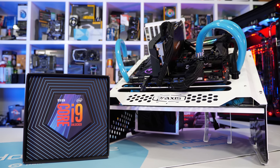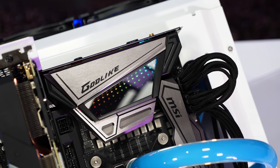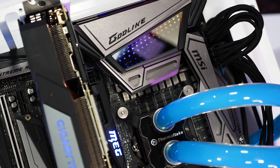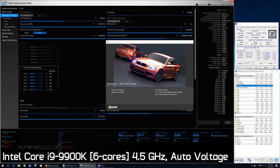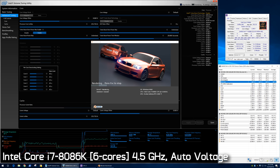For the first test configuration, I locked both the 9900K and 8086K at 4.5GHz on the MSI Z390 Godlike. Blender was used to place full load on all cores, with both CPUs tested with just six cores active and voltage options left on auto. This saw the 9900K running at 1.16V, peaking at 61 degrees core and package temperature. The 8086K ran at 1.26V and went as high as 74 degrees package with a 72 degree peak core temperature. So the soldered method reduced temperatures by 11 degrees — a 15% reduction — though voltages were also 8% lower. The package TDP was 16% higher on the 8086K, hitting 125W opposed to 107W for the 9900K.